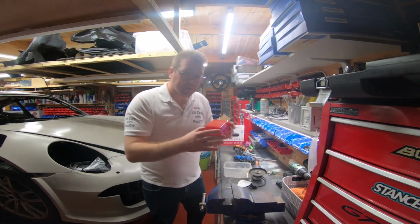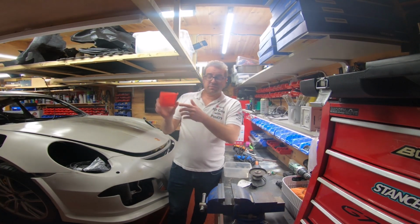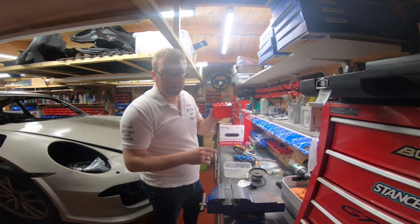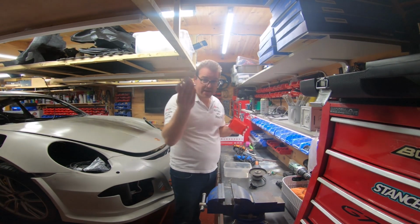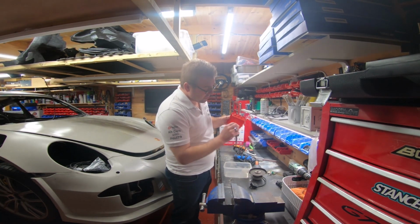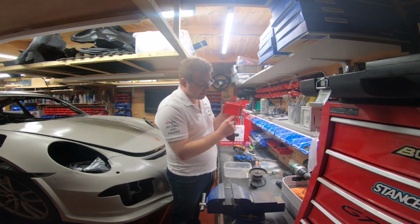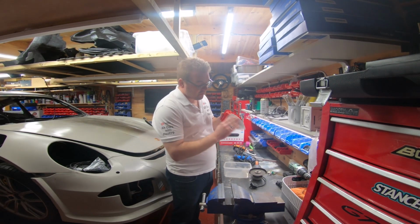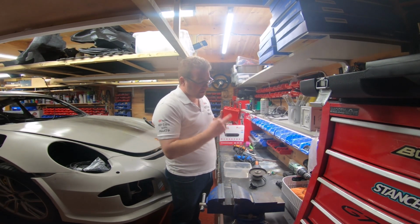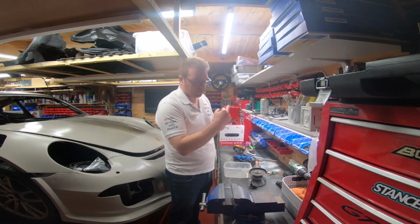The thing about back trimming is that what I just described is actually quite difficult to do. With back trimming, you get your sander. Imagine this is my angle grinder spinning around, and all you do is grind away that lip. If I ground away that lip, eventually that lip would not exist. And if I did it all the way round, imagine this is a perfect square shape.